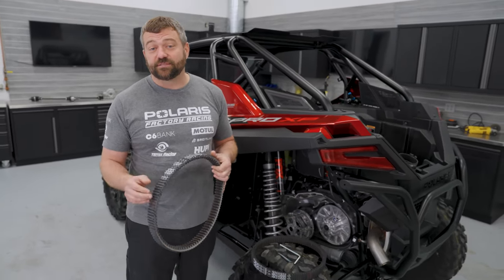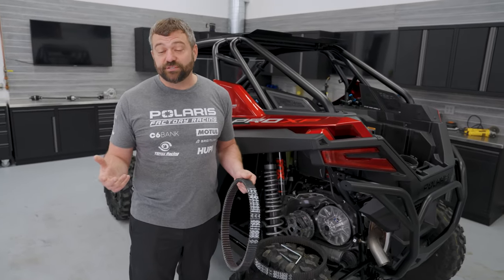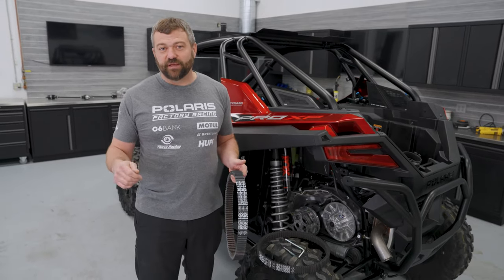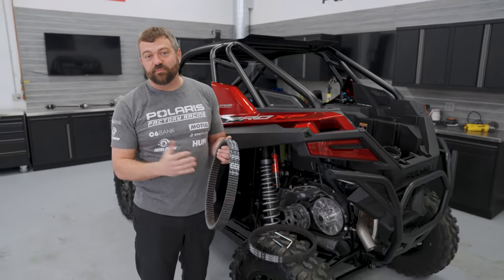In real technical terrain, again be in all-wheel drive, keep it in low gear going up and over obstacles, and when running in dunes, all-wheel drive is your best friend. Think of two-wheel drive like a boat pushing a bow wave versus all-wheel drive like a boat coming up on plane — it's a lot less load and much easier on your belt.